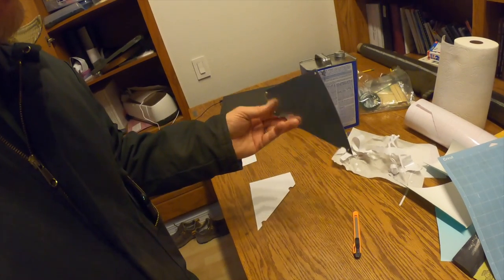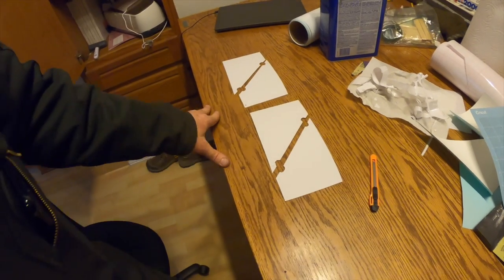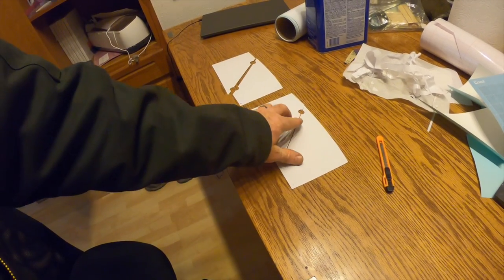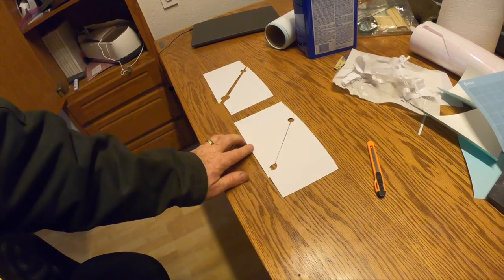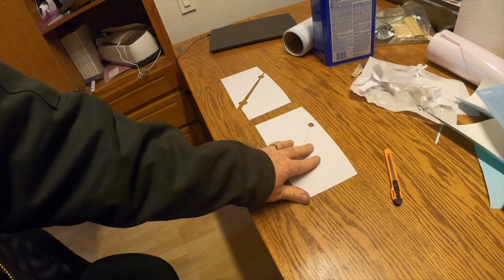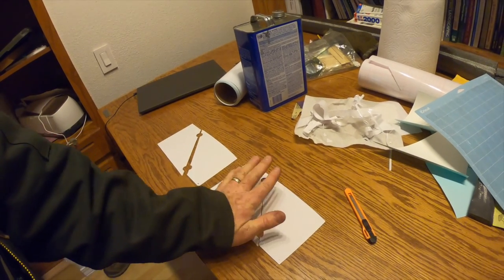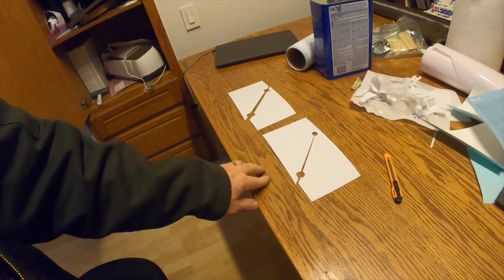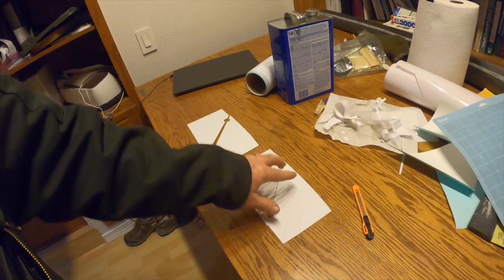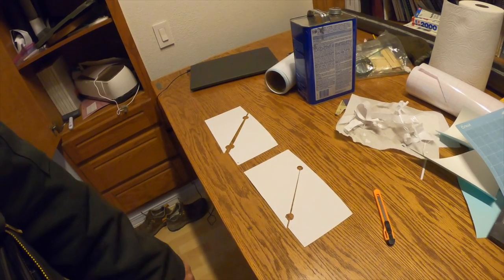I went ahead and took the backing plates for the fuel sight gauge and wrapped them with white vinyl. I had to decide between white, carbon fiber, and black for the best backdrop for the sight gauges. I went with white mostly because when I go to label it, the lettering will stand out better with a white backdrop. I think the white will stand out really well to see the sight gauge with the black carbon fiber all the way around the opening. Later on when we do the fill test, we'll fill with five gallons per side, isolate each side, and mark off as we go up with the gallons — creating both a tail-low position on the back and a flying attitude position on the front so we know how much fuel we have in both situations.